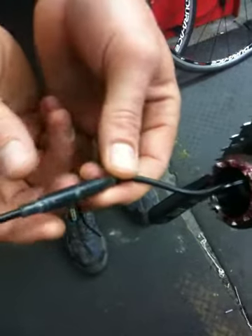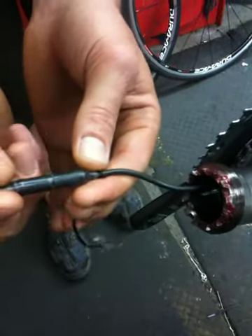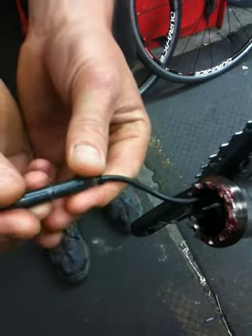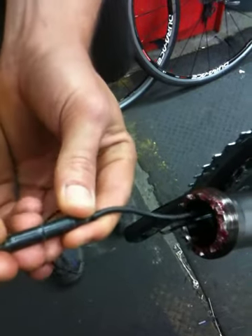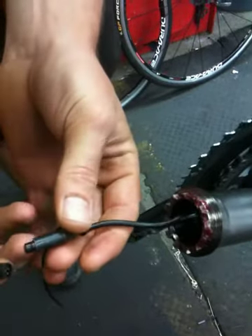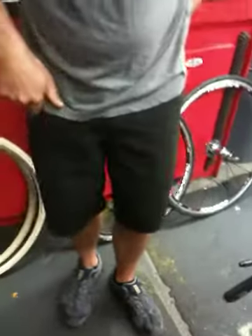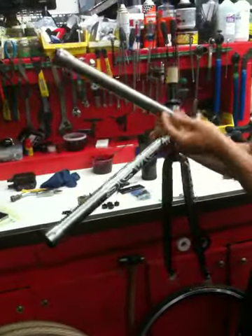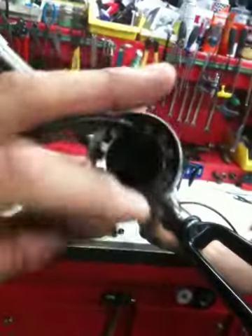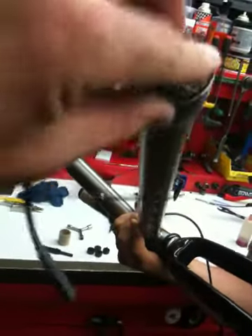When you reconnect it, wherever you arrive and start riding your bike, you're probably going to want to use a piece of shrink wrap or wrap some electrical tape around this. The more secure the fitting — like a piece of shrink wrap tubing — the more waterproof and the longer the whole system is going to last. A piece of electrical tape or duct tape will work as long as it's sealed. The connector does go together in a specific way, so make sure you pay attention to that. We'll include some shrink tubing so you can always re-shrink wrap it — just use a cigarette lighter to melt and shrink it. The zip ties inside the tube simply take up space and force the wire up against the side to keep it from rattling.